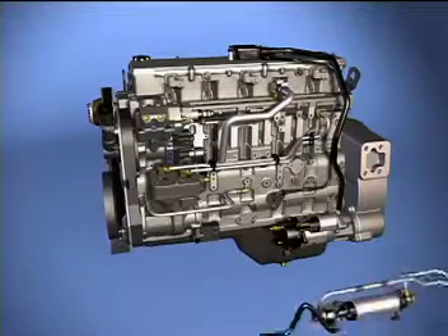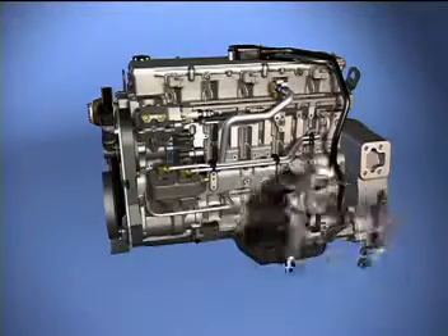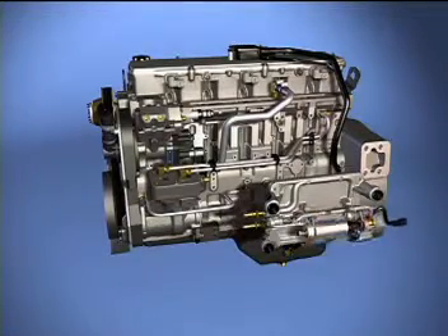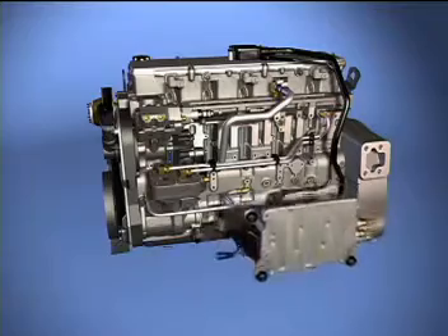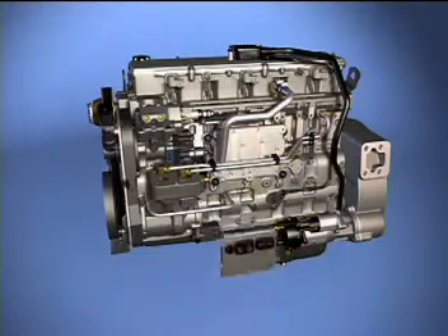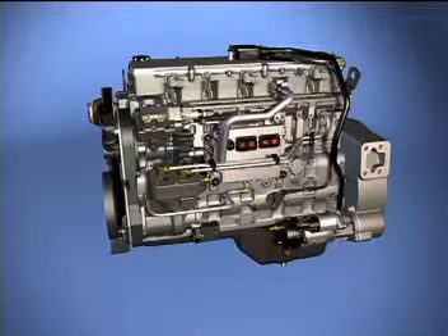The HPCR system uses an electric lift pump to deliver fuel to the HPCR pump during cranking. The pump mounts to the ECM cooling plate. The CM850 control module for these engines has expanded functionality over the previous CM554.